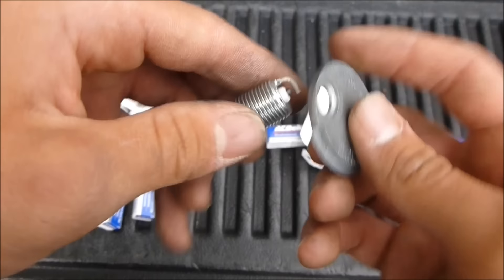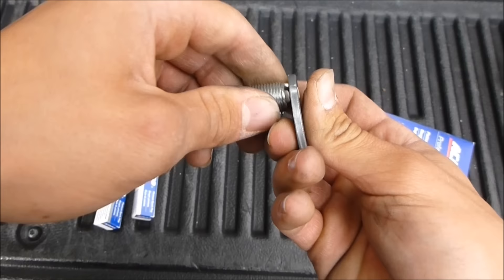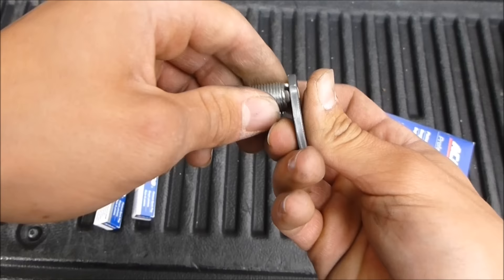Now I use this inside gap tool. Be careful with the platinum — the puck, you can actually see it, so I'm not even going to touch the puck. I'm going to just do this and pry it like a can opener, gently, because you can actually open it up a lot. Perfect — 0.05. So that's how you gap a spark plug.